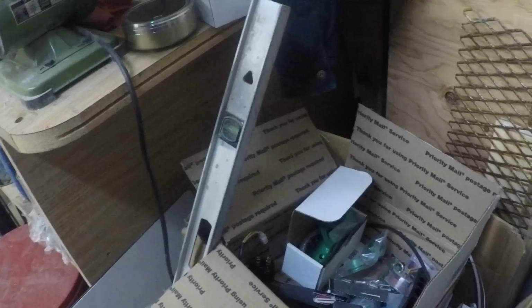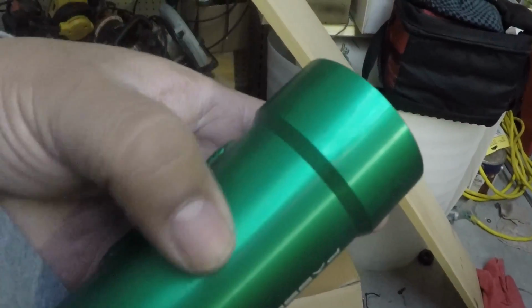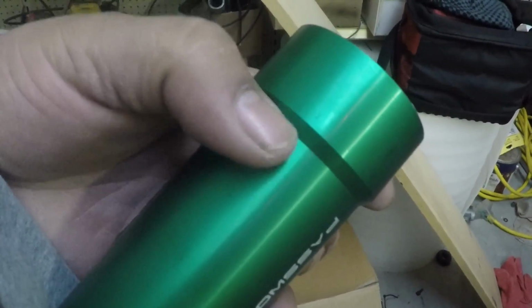And this is, I bought this coolant overflow tank because I had bought one for my last build, and when I got the engine in, I realized that the GY6s do not use radiators. So I think I'm going to use this as like a catch can. You basically use this, plug up this hole, drill another couple of holes like right here or down here, and thread them, and then put some inserts, put a valve or a filter on this side, I have to vent it, and a hose on this end. That way I can use it. This was like $70 for that thing there.